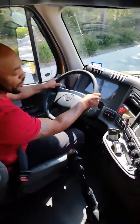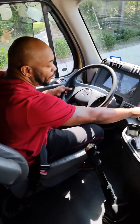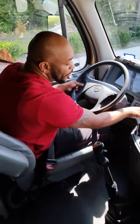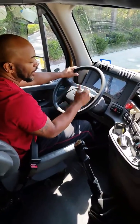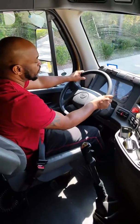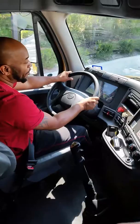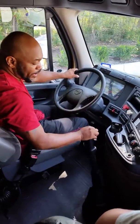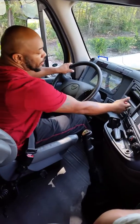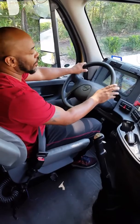It's working. Now we're going to do our service brake test. We're going to mash in the parking brake — now both brakes are released — go about five miles an hour, then clutch and brake to check the service brakes. It's working. Put it back in neutral, engage your brakes, and that will complete your tug test and service brake test.